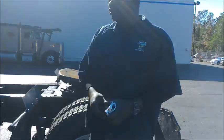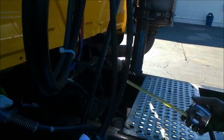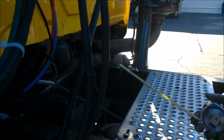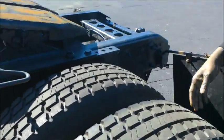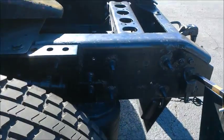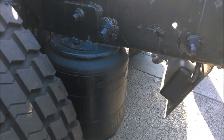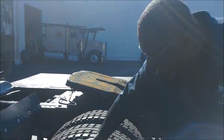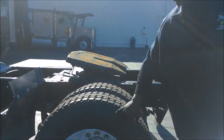After you do all of that, you want to check all your air bags — check for any type of cracking or disfiguration. These look pretty new but check them for any type of visual damage. Before I forget, definitely check your tires on the outside for any type of zipping, crackling, or anything like that.